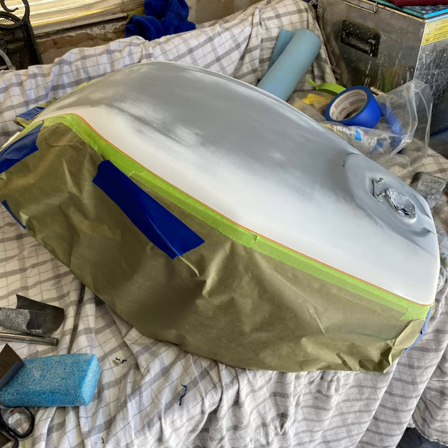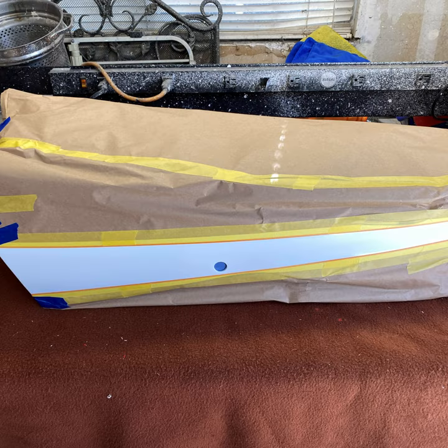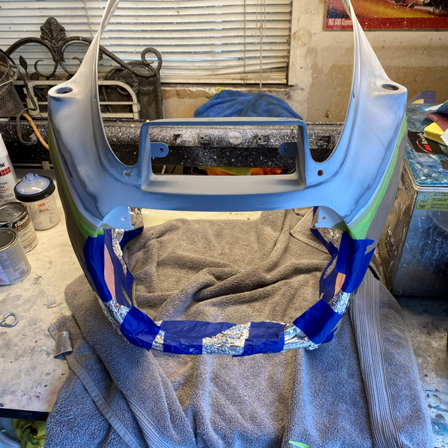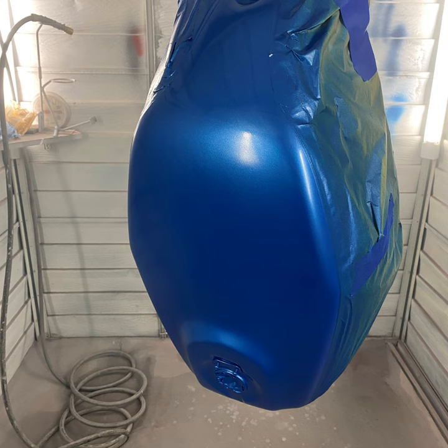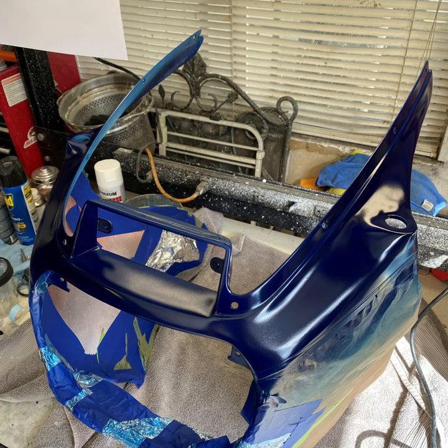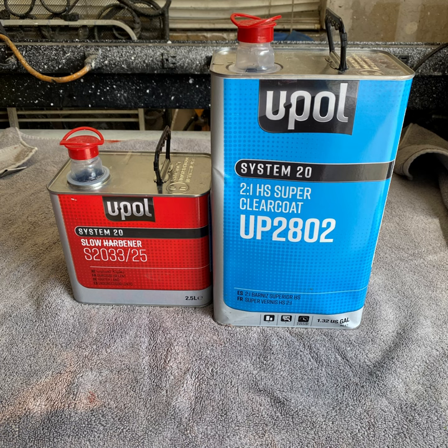With the fighting red fully cured, I can remove any remaining masking and mask off the candy blue areas. I then lay down the 1000 blue metallic base coat, followed by the candy blue top coat. It's important to be extremely consistent with the candy coat and avoid too much overlap or hold over at the end of each pass. In order to get the depth of the candy coat just right, I practiced on spray out cards for several days, making minor adjustments until I got a good match for the original finishing.